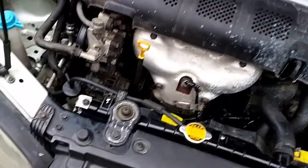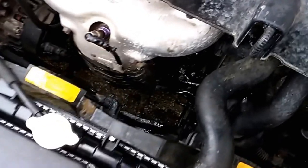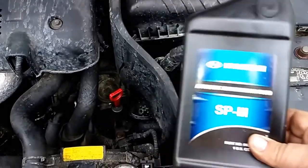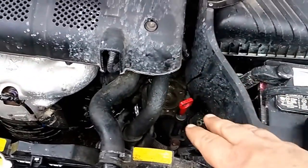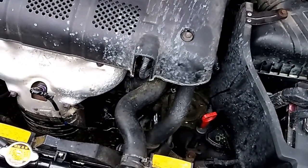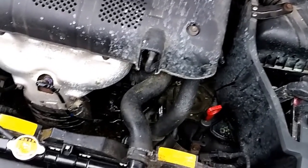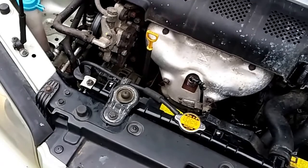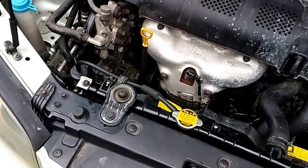The fluids are all topped off, I've let it run, and the fans are on right now — I've let it cycle the fans a couple of times. No leaks, everything's good, got good pressure on the system. Had to top off the transmission fluid — I had about a half a quart left and it took just about all of it, just a hair low. I'll leave it that way, drive it on perfectly level ground, then take another quart with me on the way to work and check it at the gas station after a good highway drive when it's getting hot.